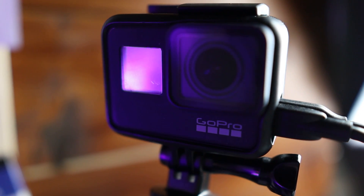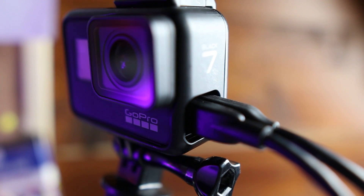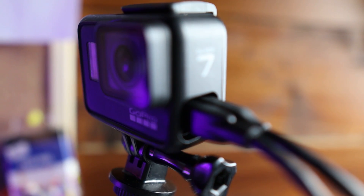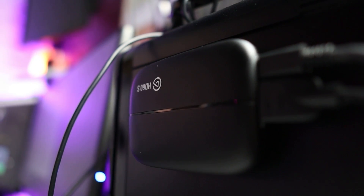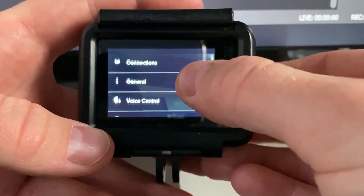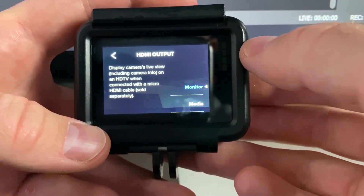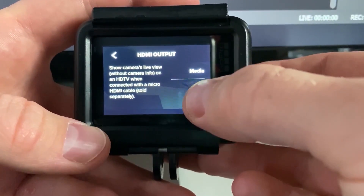The first thing you need to do is connect the GoPro to the computer via a micro HDMI cable. You need some kind of capture card like an Elgato Cam Link or an HD60S — something along those lines from Elgato. Elgato is a company I'd recommend for capture cards because they just work; they're simple, plug and play more or less. You have to make sure the GoPro HDMI output setting is set to live — by default it's set to monitor so you can connect it to an external monitor. Just reset those settings in the GoPro preferences to live and you're basically connected to the computer.